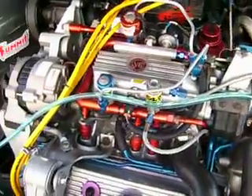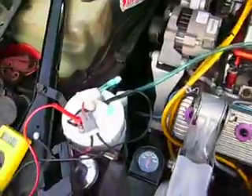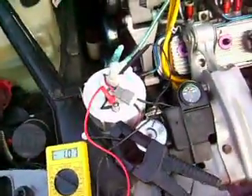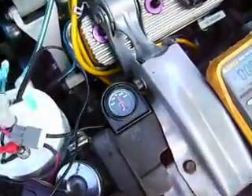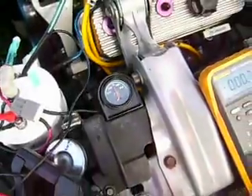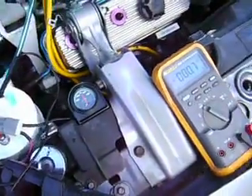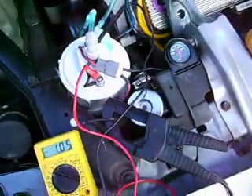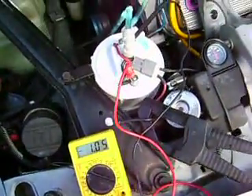It's on the correct side of the throttle body butterfly valve so that we are not applying vacuum to the Smack unit. Here's the unit installed. I've got a few extra wires here because I have some meters hooked up. I do have an ammeter I use on the road, but for this demonstration I've got a Fluke inductive ammeter and a little voltmeter hooked up.